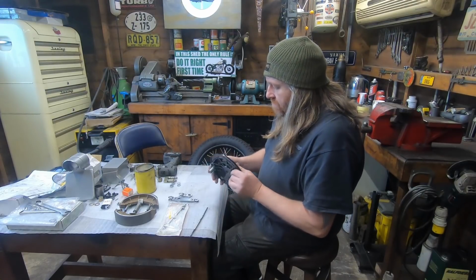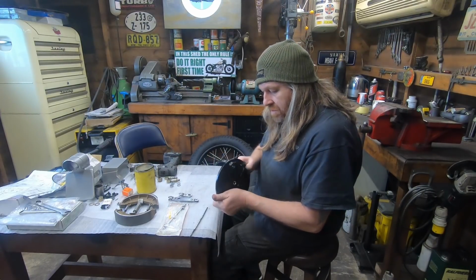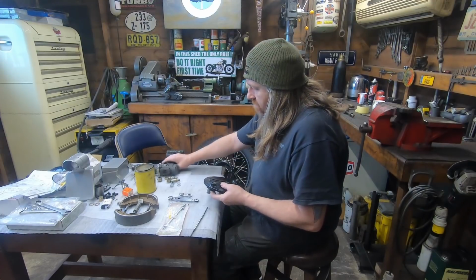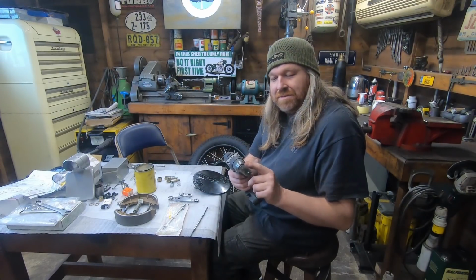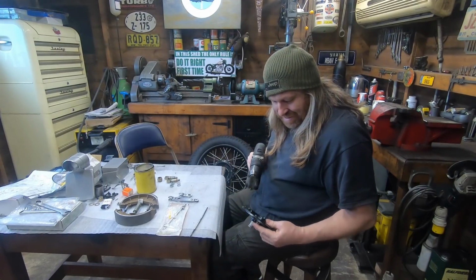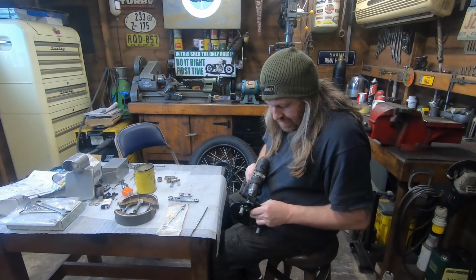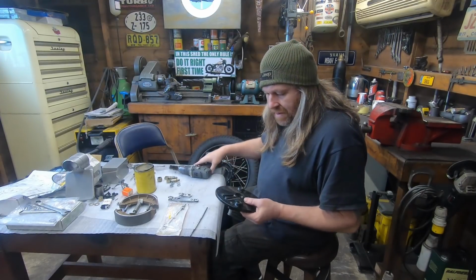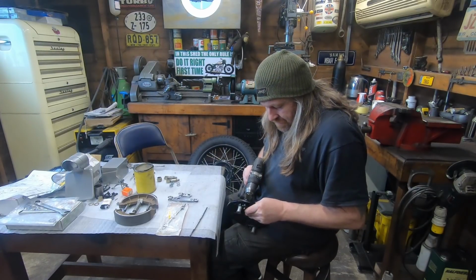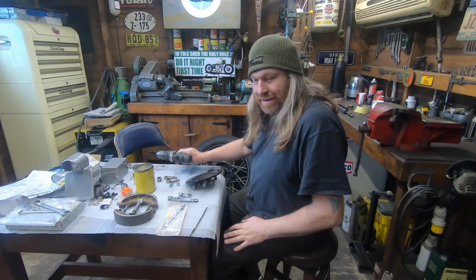and get it together. So I'm just going to make sure these holes are clear for the brake cams, because they've got to be nice and free. We can't have them sticky because obviously the brakes can stick on and bind. So I've just got this. This is actually a shotgun cleaning brush. You can see that. It's ideal for cleaning little bits like this, just to make sure all the muck's out of the hole. I think they're pretty clean anyway. The powder coat is quite good at bunging things up and masking stuff off. Unlike some powder coaters, if you don't tell them, it will get powder coated.